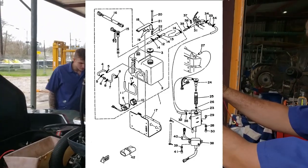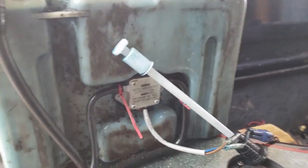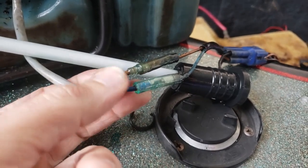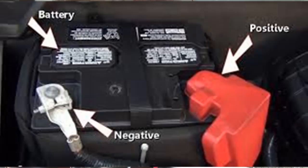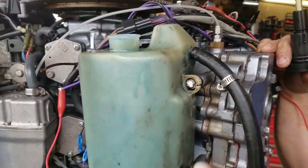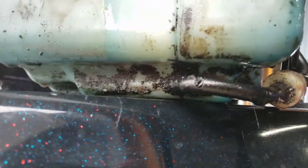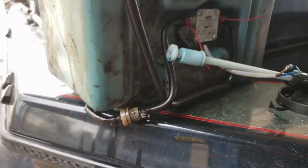We've done some electrical diagnostics on the Yamaha OX66. We've removed the oil tank to verify that the pump is good. Brown is power, blue is ground — if you send power and ground to that you'll turn the pump on and it'll pump oil out of the hose on the right side, which loops around and feeds the engine oil tank via that hose. There's a little inline filter on the suction side that a lot of people say gets clogged — I'll be honest, I've never seen one clogged, but it's possible.